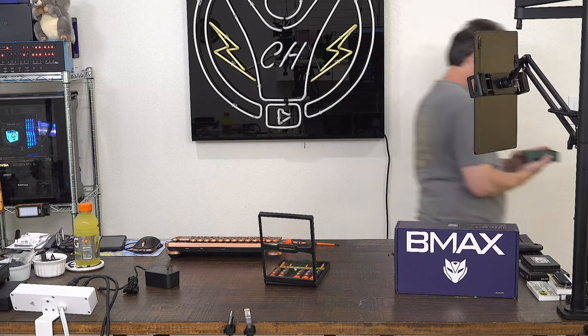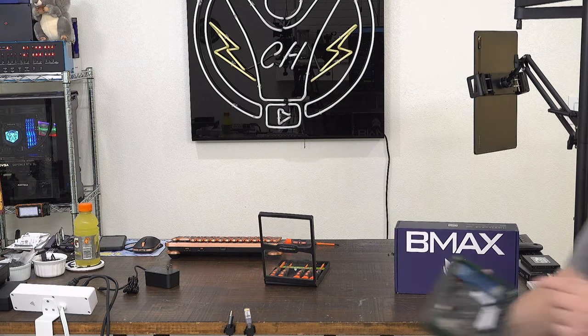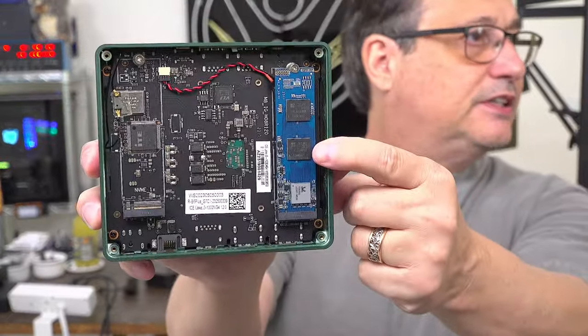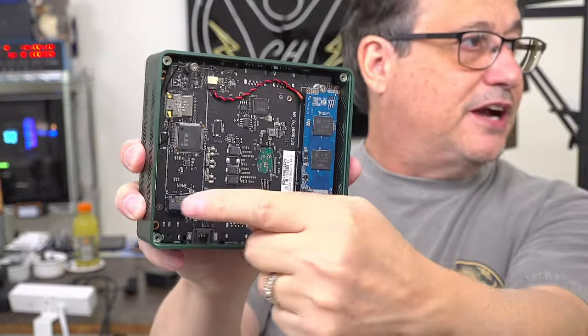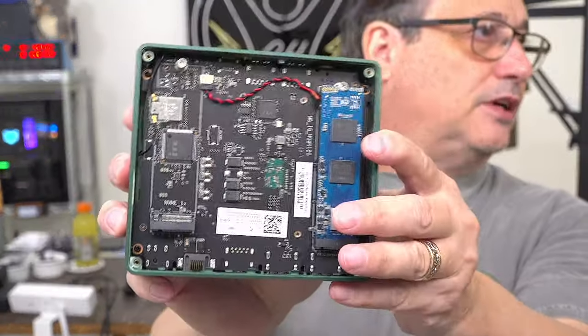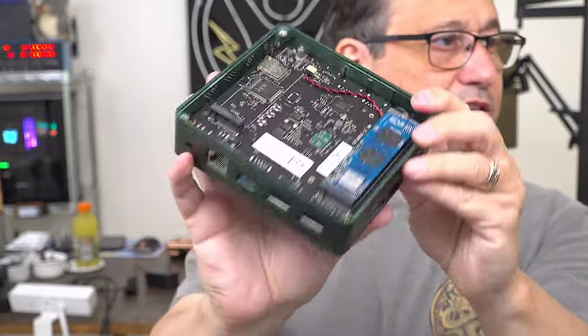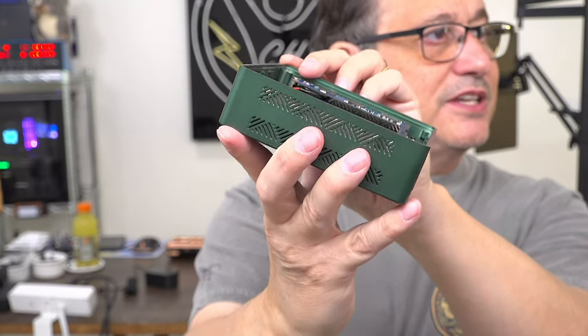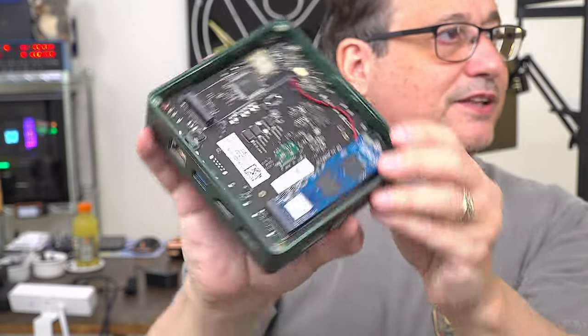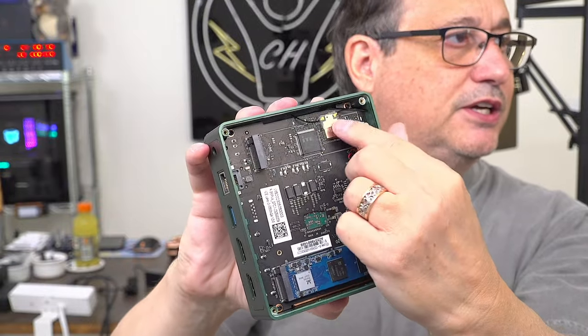All right, well, little of everything. We do have a socketable NVMe drive. We have another M.2 slot we can use that's only NVMe times one. I think it says 1x. So I think that's saying that's the speed of it. Now, a lot of times the Wi-Fi controllers are located underneath the M.2. But if we look underneath this M.2, we can see the CMOS battery, but nothing else. The other M.2, we see the two wires, right? Because if an M.2 was right over this, it'd be covering up that.